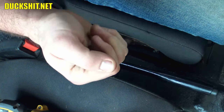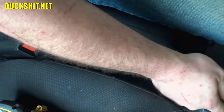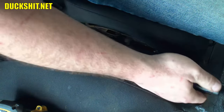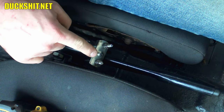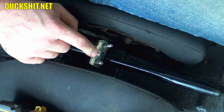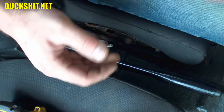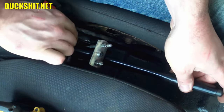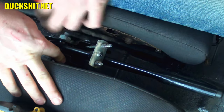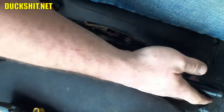I did feel the shoes just seat themselves, so now I'm gonna have to go in the back and adjust the shoes a little bit. I mean, I probably could just bullshit it and tighten the cable, but that's a no-no because down the road someday, you're gonna have to tighten the cable, and if you tighten it now, you won't have any more give in the back later. So what I'll do is I'll adjust it in the back, make the shoes just a little bit tighter, and then I think we'll be good from here on. But I think this is gonna work. Looking down in the tunnel there, it looks like everything's working the way it's supposed to also. The cable is going where it's supposed to be. I need to get a nylon lock nut for that.